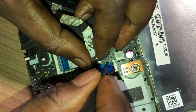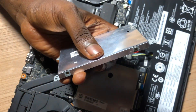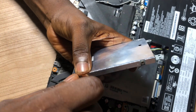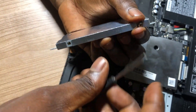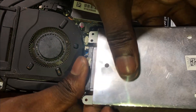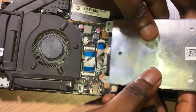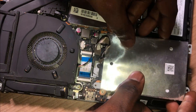You need to place it carefully. I had to use the screwdriver because it was hard for me to fix it in, but finally I was able to fix it in. Then I screwed the hard drive to the bracket that holds the hard drive. Make sure the part labeled SATA is facing downward — below the laptop — and then plug the flex cable into the hard drive. You can see it here — it's plugged in, just close to where the hard drive sits.